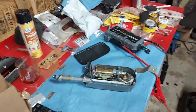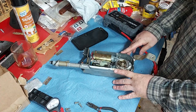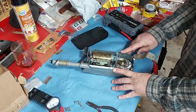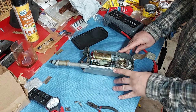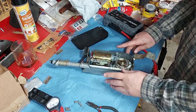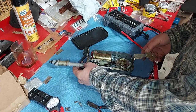We'll lubricate the antenna mast, then hook this back up to the car and check. It could be there's a cable missing from the back of the radio or a fuse issue. I heard clicking when I pressed the switch in the car, so we're just going to have to troubleshoot that.